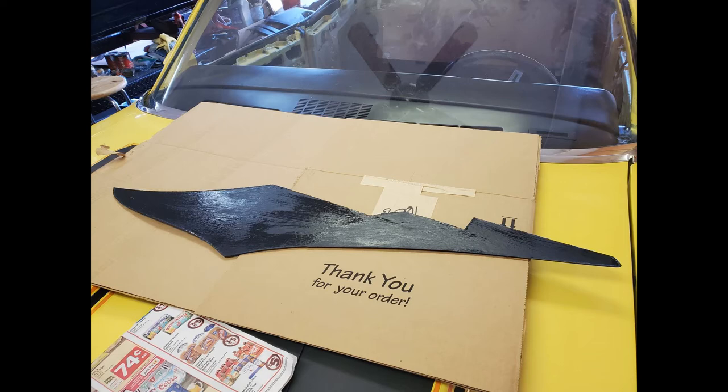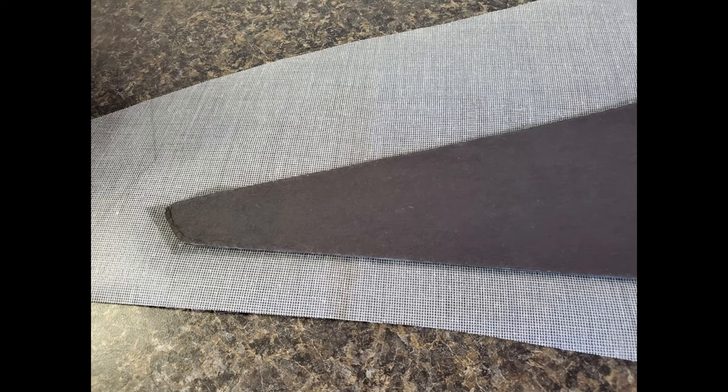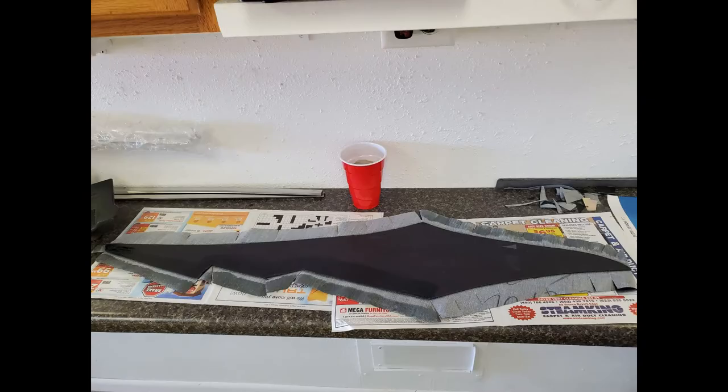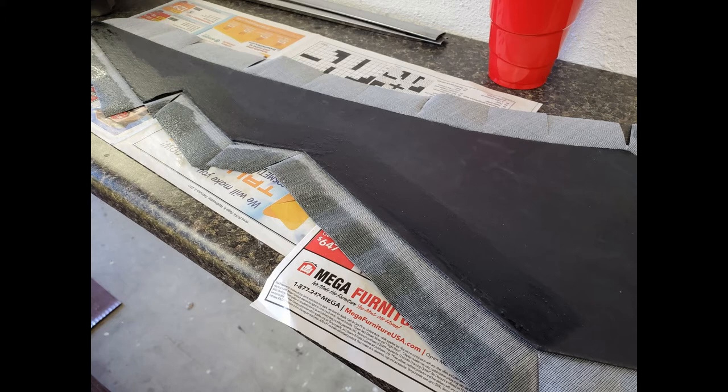I also coated the fabric with glue and let it dry until it doesn't stick to my fingers — it's barely tacky, but the glue will not stick to my fingers. After pressing the pieces together, I don't have a lot of excess glue where I don't want it, which should make it easier to manipulate the fabric when I wrap it around the board. Once the pieces are glued together, I let it sit for about an hour before moving forward. With my 1970 Cutlass, there are two areas that won't wrap around behind on the sail panel board — those areas will wrap around the headliner rail when you install the sail panel in the car.